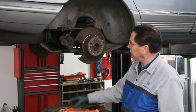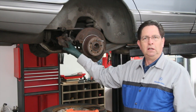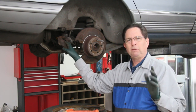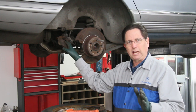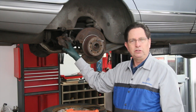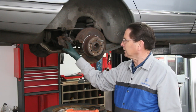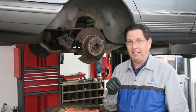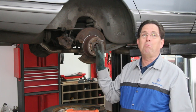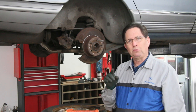The reason for all this: we look at this caliper up here — this caliper is seized, it's frozen. That's something you want to learn how to check. I have a video available on YouTube that talks about how to test your brakes for frozen or dragging calipers. Obviously this didn't happen in just 30 or 60 days. This was months of driving with a seized caliper, and you have to be really careful.